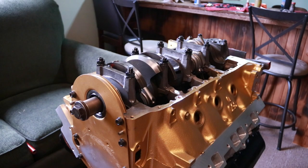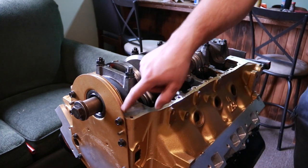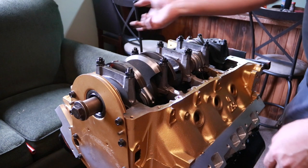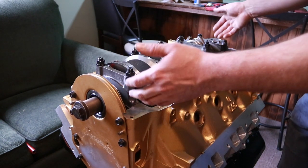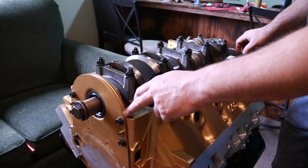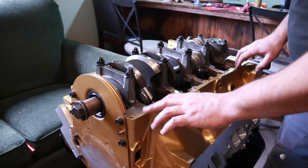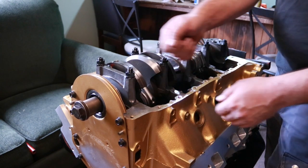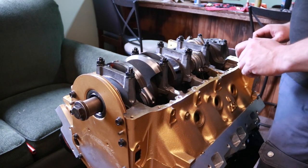Now, when it comes to putting the oil pan on, there's a couple of key areas that we need to focus on making sure we get sealed up, most notably the corners on each end, where we have a rubber seal that covers the arc area, and then we transition to the cork gasket. Some engines will have a one piece, which is really nice. You still need to dab a little bit of silicone in the corners where it might leak. Because we have basically four pieces for how this is going to work out, I'll be putting some in the corners there on the bottom side, as well as putting it on the top side before we put the pan on. I'm going to glue the pan gasket rails to the block instead of the pan. That way, if the pan has to come off, hopefully the gaskets stay put and we don't have to worry about scraping it loose off of the pan or anything like that. We just want to glue one side down to hold in place, and then it'll seal up with the bolts.